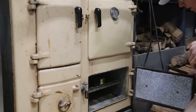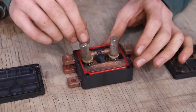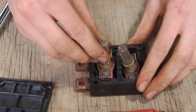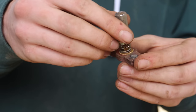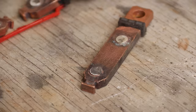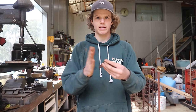To deal with the moisture we're going to stick the coils in a very low temperature oven for a while — the dry heat should evaporate the moisture. In terms of all these contact points, as you can see the pins are pretty grubby, so we'll clean them up. The main points of interest are the contact points on the back side — they're very grubby and they're not flat either. With a winch, to get your best retrieve speed you want the highest current, and that's achieved by having the greatest contact area, because any limiting in contact area is going to lower your current due to resistance.